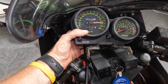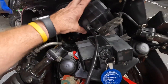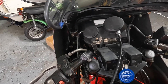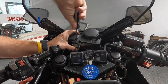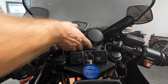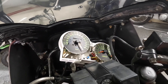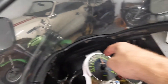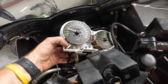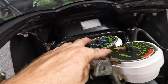I'm going to try to pull this speedo apart right here so I don't have to worry about unplugging it, because if I do I'll have to undo the whole fairing. Let's just take this guy apart. There we go — see, it doesn't return. There's supposed to be a return spring on here. I think that's what's doing it — I'm missing the spring somewhere.